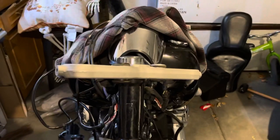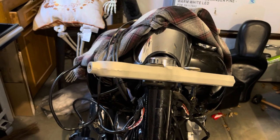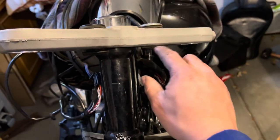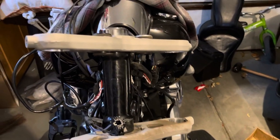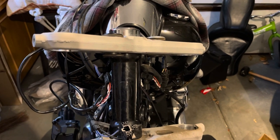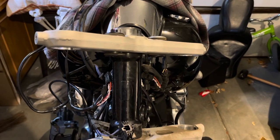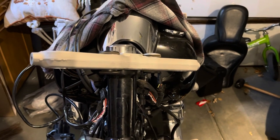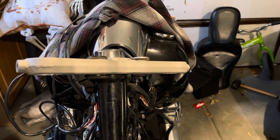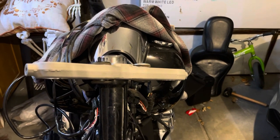One thing I'll mention: if you're planning on upgrading your bars, you might as well do this at the same time. You can get by using the original bushings depending on how old your bike is — mine's a 2014 with only 7,000 miles, so I probably could have gotten by without replacing them. But if you're going to replace your bars, you might as well swap in polyurethane bushings. It's so much easier to get them out while everything is apart. Spend 15–20 bucks on bushings and take care of it now.